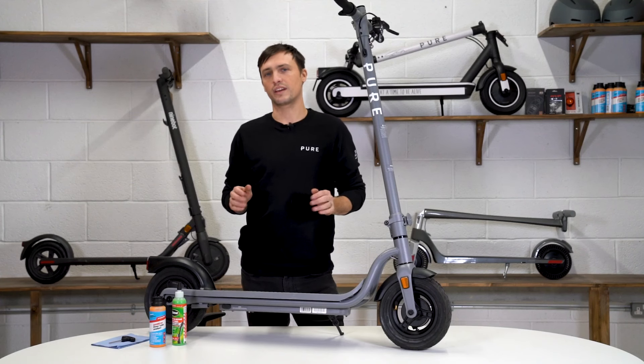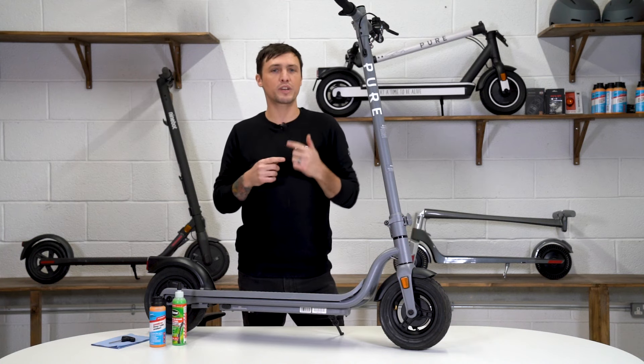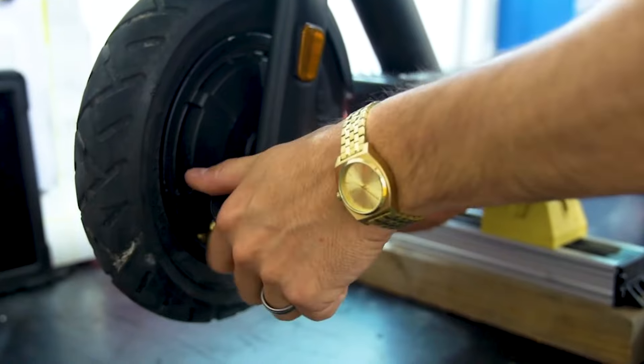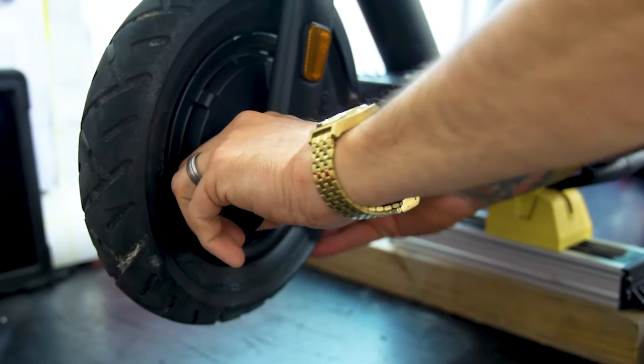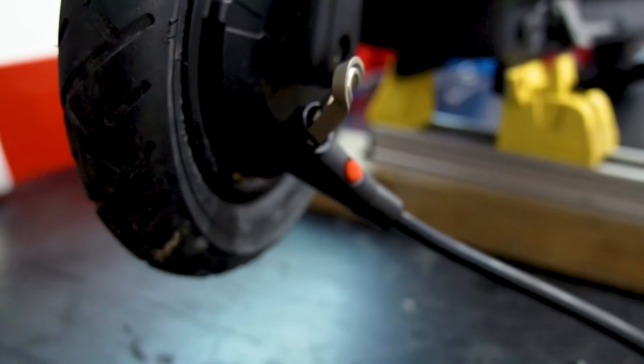While PPF can do lots of things, it's important to understand what it can't do. PPF can't seal a hole if the tyre is already deflated — it relies on the rushing air and the rotation of the wheel to help. PPF can't guarantee it's going to stop all your punctures; holes bigger than three millimetres let the air out so quickly that the PPF doesn't have time to act.